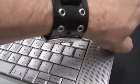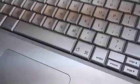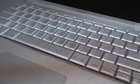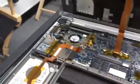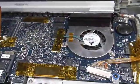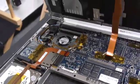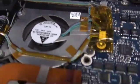Now I should be able to actually pry this open like that. This comes a little easier than most because I've already opened this machine up — the first time it was really tough. I have to open the machine up this way, and there's a connector there that keeps me from removing the keyboard completely. There is the problem fan, and there's the fan that's okay. You can see the rest of the insides here.